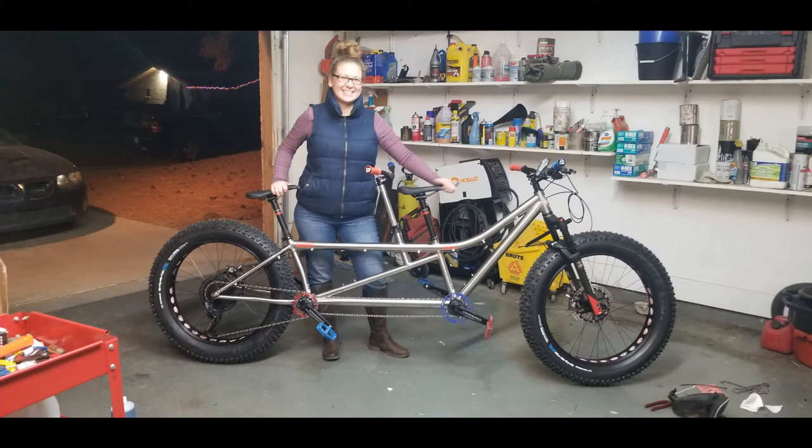The final build required making custom shifter cable housing. When we got the Green Goblin tandem that you see in this video, it was a basket case — the bike had sat outside and the sun had eaten every rubber and plastic piece, including the grips, cable housings, saddles, tires, and brake pads. We rebuilt some of it in our hotel room, then took it out bar hopping in Tempe at Arizona State University. Back in New Mexico we replaced all the cables and housings, which were nearly 20 years old. Those of you new to tandeming will want to do the same — keep boxes of housing to cut to length and multiple shifter cables on hand. This tandem, the Danger Zone, has a wheelbase of over 1,900 millimeters — nearly double that of a normal bicycle — so custom cables and housings to reach the derailleur and brakes are a must.